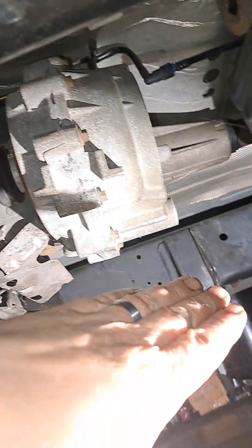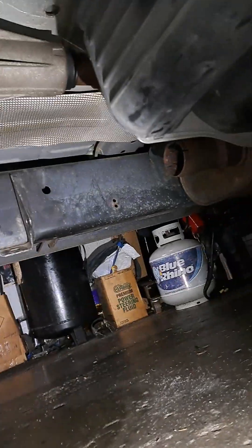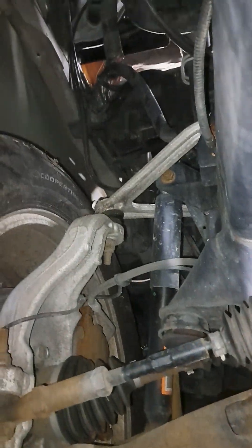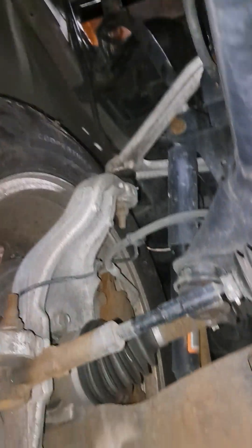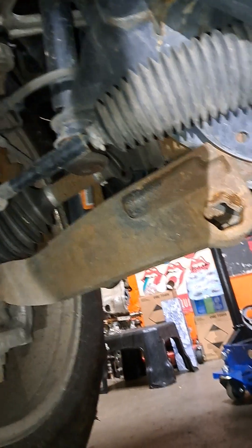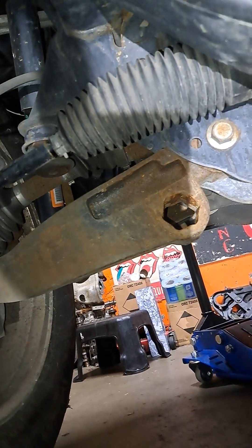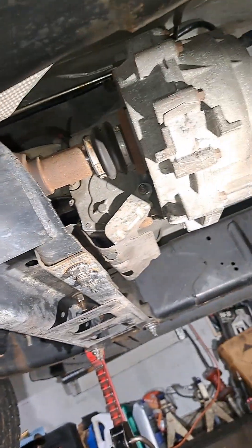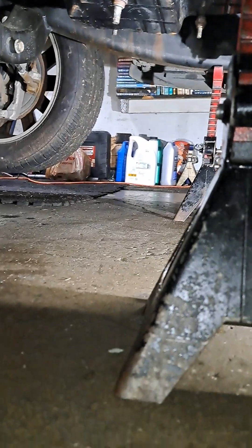There is a cross beam that the torsion bars will go to. There's your exhaust that's off — that's gonna run all the way back. I took a precursory look in the back and it looks like that stuff is in there. I'm looking for suspension stuff to explain why that thing was sagging so much. The driveline looks okay, that's good.